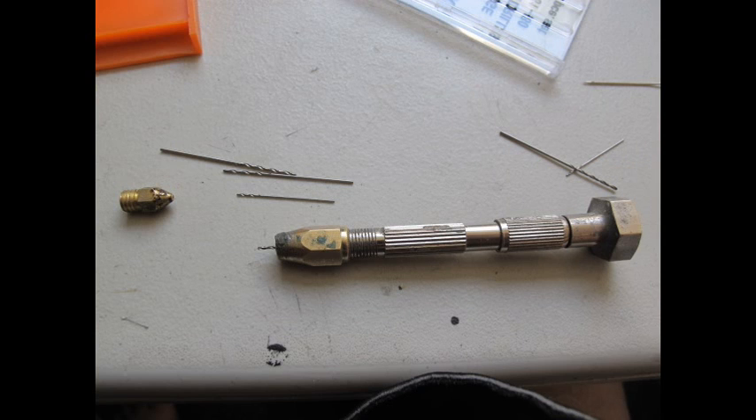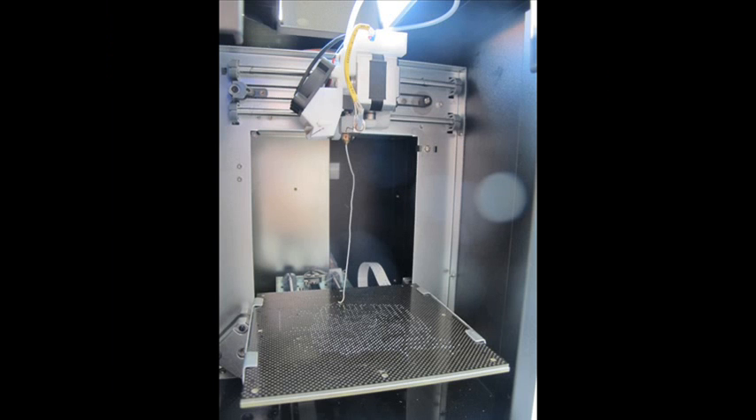24 hours later exactly, and at this point I'm pretty nervous not knowing if what I'm doing is going to work. The plastic within the nozzle hole is soft but still not coming out — otherwise I'd recommend soaking for another 2-3 days. But I happened to have some micro drill bits. The hole is exactly 0.4mm and I have drill bits smaller than that, so using a 0.3 or 0.2mm bit, very carefully, I drilled the hole out. Be very careful — brass is a very soft material and can be drilled through by hand. Make sure you're only drilling and the remnants coming out are plastic-coloured, not brass-coloured.